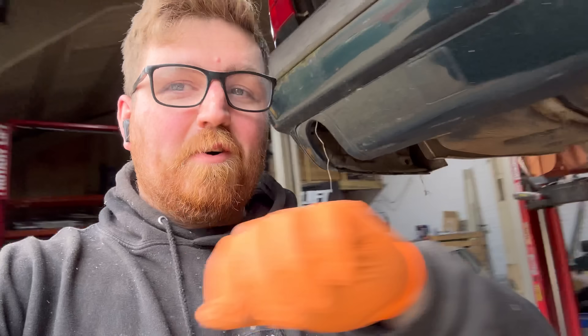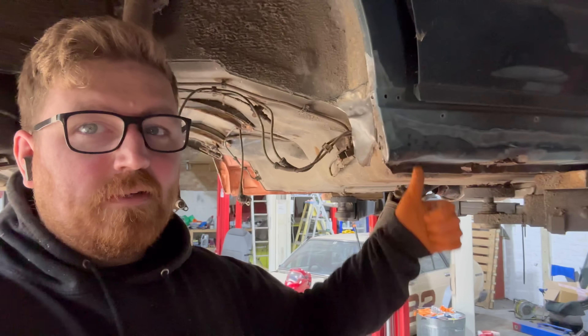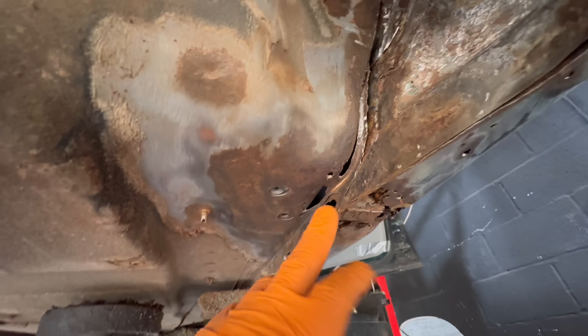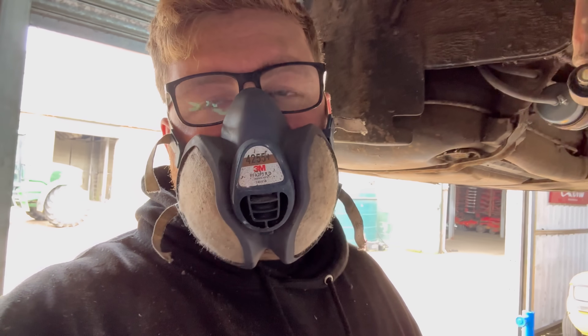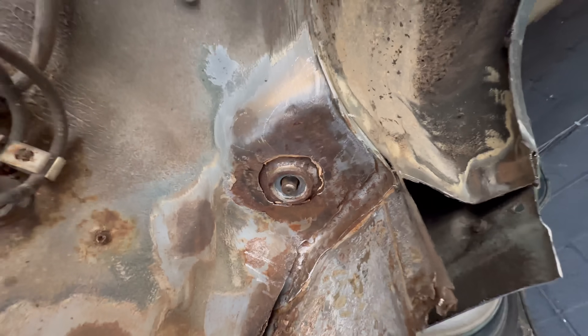It's currently Friday and today's video is going out this evening. It'll have to be spread out over a couple of days - wish me luck. Arguably this one is a lot worse and I have to take this top section of the arch out to replace, and probably a lot more of this bit here, so it's going to be a lot more work involved. I've just realized something - you can hit that subframe stud up into the cabin. I thought they were welded on - I've just been working around that stud. I'm going to just hit it up. Nice to find that out now.